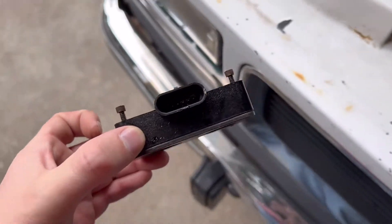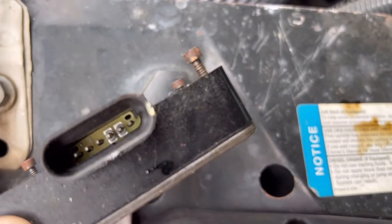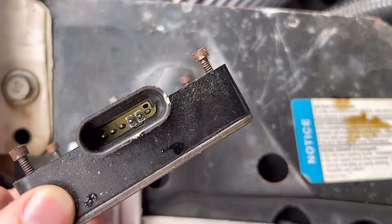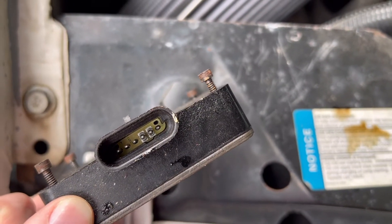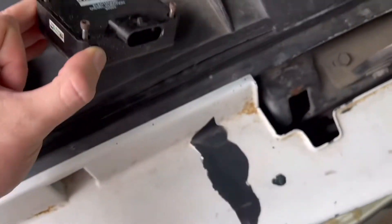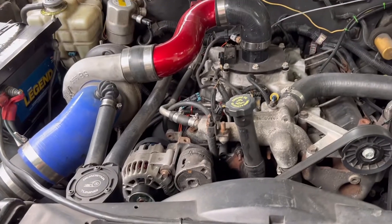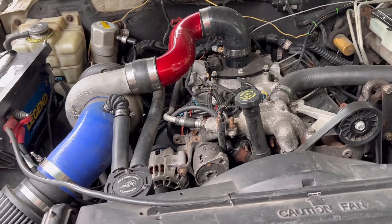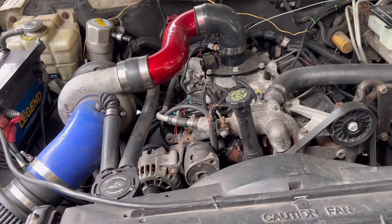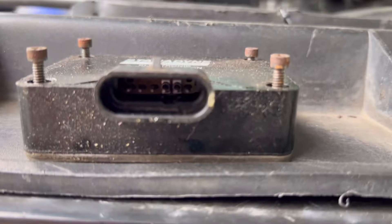Something that people don't realize is that there is a resistor in here. If you look down inside, this is a number 6 — I usually run between a 5 and a 2. If you don't have a resistor in your PMD, you can have random idle problems, rough idles, spastic throttle, hard starts. So make sure that your PMD has that little fellow down in there.